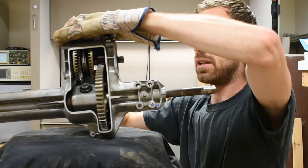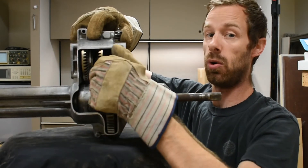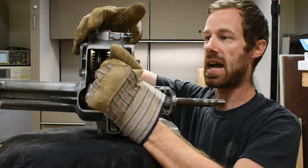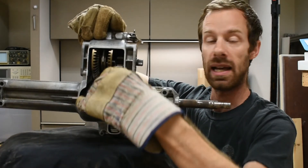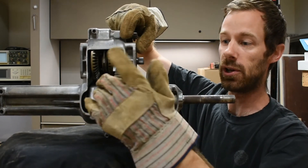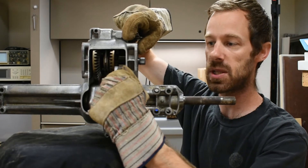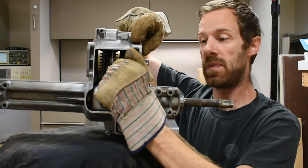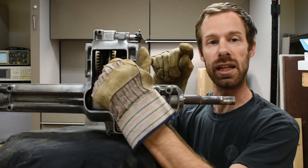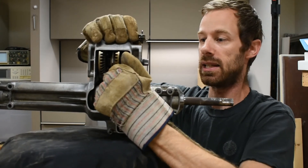Shifting it into neutral, you can see that in neutral you don't get any spin direction at all. In fact, it's quite easy to rotate that spur gear. As soon as it engages, however, it becomes a whole lot more difficult. Make sure if you ever want to push your lawnmower, it's in neutral and it's really easy to spin. Now here's something interesting — right now I have it pulled as if you're on the shift column trying to engage it in one direction, but it's not fully engaged yet. I have to give it a little bit of a spin until finally it locks into gear. That's why sometimes when you shift, it seems to kind of lurch forward a little bit before it finally grabs and locks into place — because those pins might not be aligned with that little disc that has those holes around it. It may not be perfectly aligned right when you shift it, but all it takes is just a little bit of motion and then finally it'll engage.